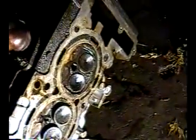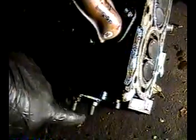So, you know, I'll take it up and have it professionally looked at and see if there's any cracks in the head. I'm not good at determining this. I'll take off the fucking manifold, of course. A lot easier to do here than with it on the head. Here are those two studs I was telling you about. When you pull the head off, you gotta pull the head up, you don't get it off the pins, and then pull it towards the passenger side front wheel to clear the bracket. You know what I mean.